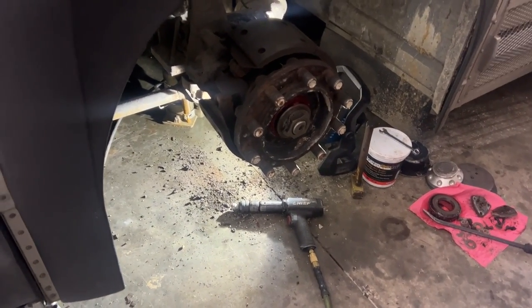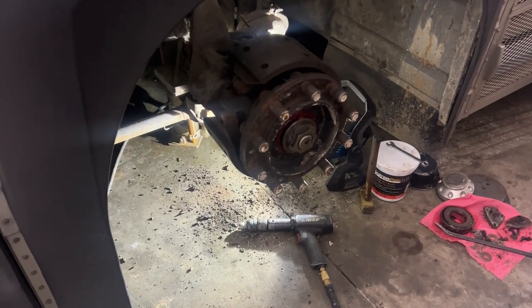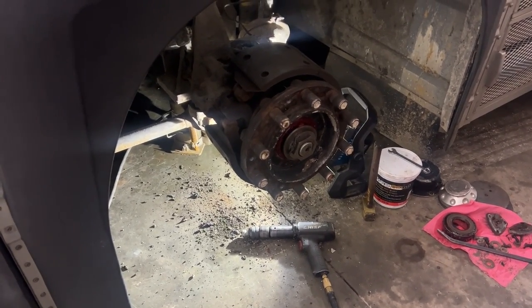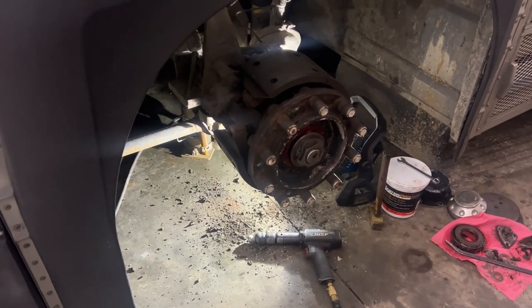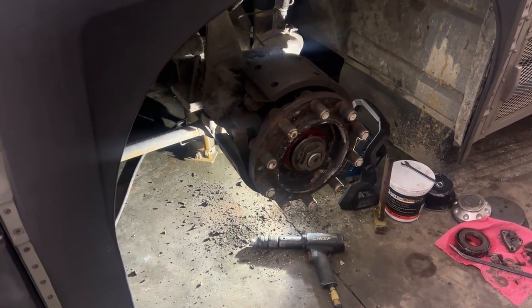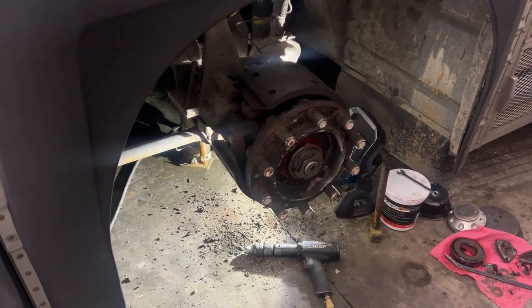I was getting ready to remove the kingpin here. Now, apparently the last time we did this, nobody tightened anything back up. Everything was loose. It comes off to get to the kingpin: the caps at the top, the wedge lock bolts. The brake pin was put on weird.